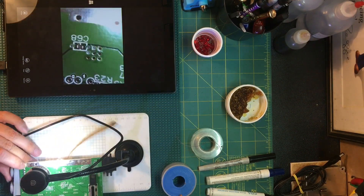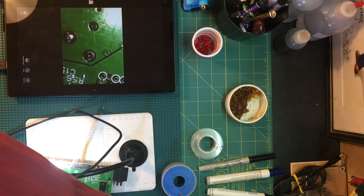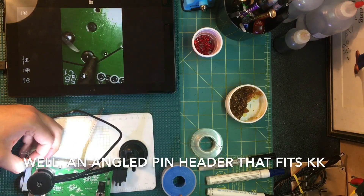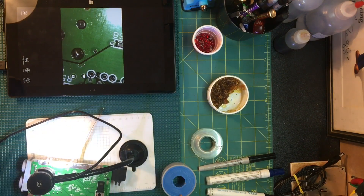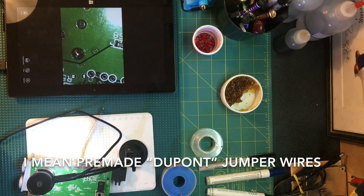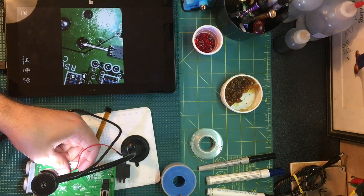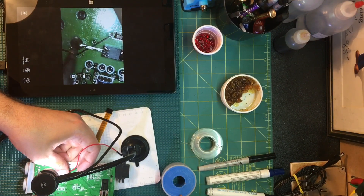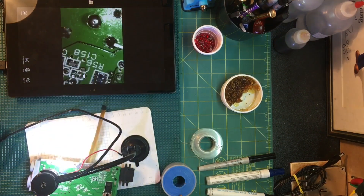Let's do the in-game reset. I go straight to the reset button — not the PIF chip — and the reason is because I add a KK header on the Ultra HDMI board itself, which has a ZIF connector for the flex, and I want to maintain that disconnectability. So I use these pre-made KK pins, which might seem kind of lazy but I have a reason, and it also saves some time.